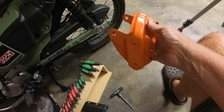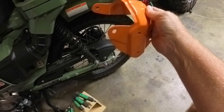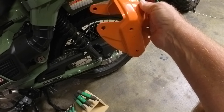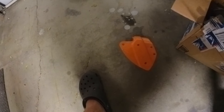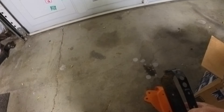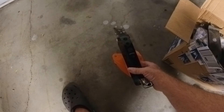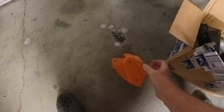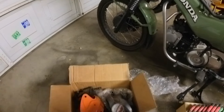Now, this is an original CT90 fender mounting bracket — it probably went around there. I've already checked and it's not wide enough to go around that fender. But this shows the two points where this strap mounts. That sits like that, and the bracket that holds the tank on goes something like that. That's kind of what I need to replicate in a bracket that goes down there. I'm going to see what we've got out in the metal pile and see if we can make this happen.